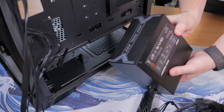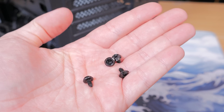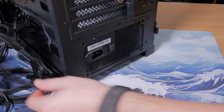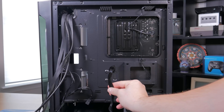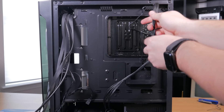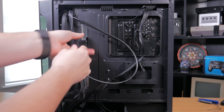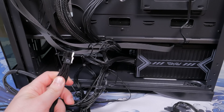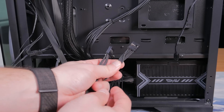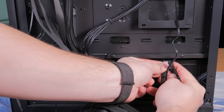Put the case back onto its feet and grab out your power supply. Insert it into the back of the case with the fan facing down, then grab four screws and secure it through the holes in the back. Now start routing cables: push the 8-pin CPU power cable through the hole at the top. Take the large 24-pin power cable and the blue USB 3 cable and route them both through the middle hole. Take the small front panel cables and route them through the lower hole, along with the PCIe power cable. Finally, route the HD audio block connector, USB 2 block connector, and the back fan cable through the bottom hole.